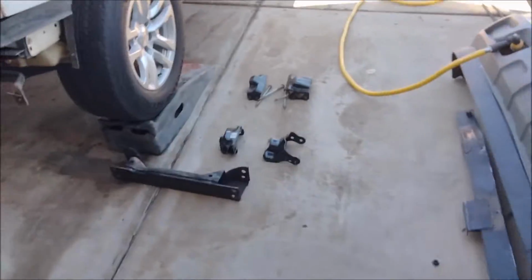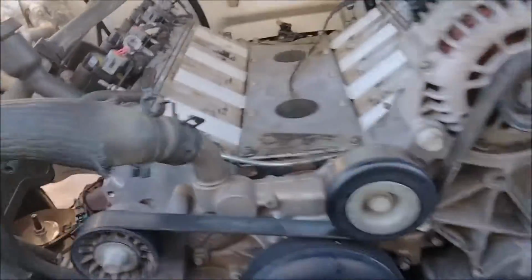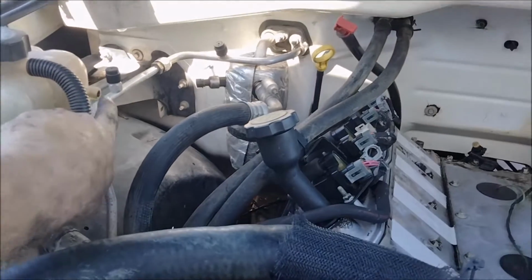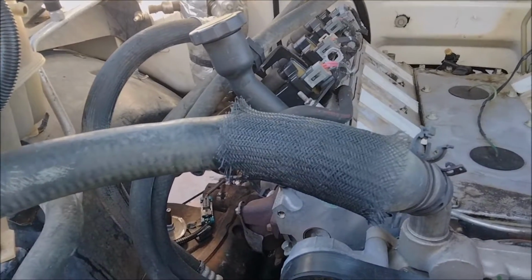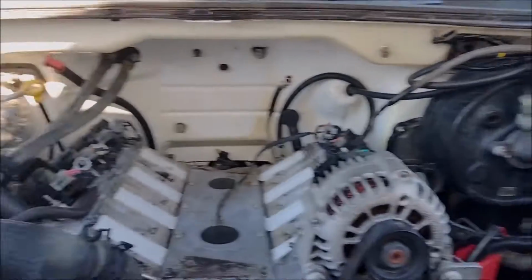The V6 radiator doesn't have this nipple. I don't feel like giving up this radiator. This right here for the LS's is just for that stupid steam hose. Normally, if they don't want to buy a radiator, or we don't really need to, I tap into that 1/2 inch hose here. I just get a brass nipple with the T. They make one that's like a 3/8 to a quarter. I use that and tap into it to here, so the steam part still works. I prefer the 4-port one. On some of the trucks, you'll see there's a 4-port, 2 lines to this line to here. I prefer that one if I can get it. It just gets the steam out better.